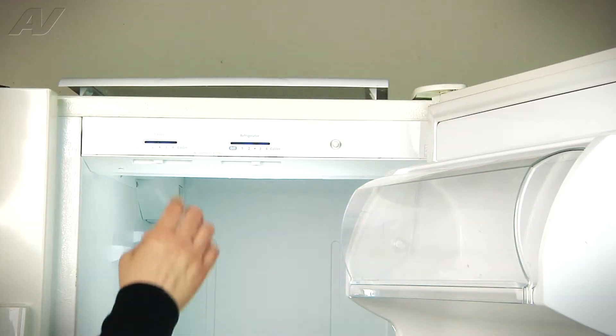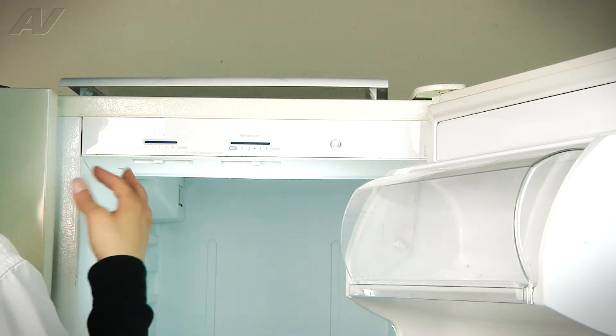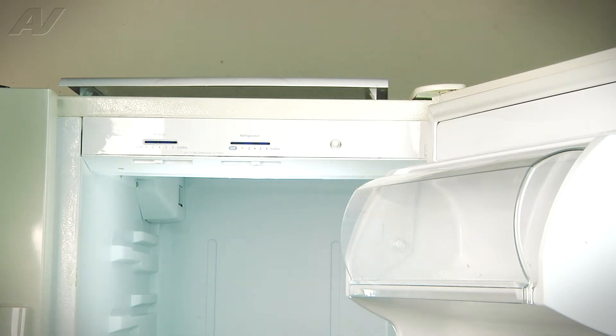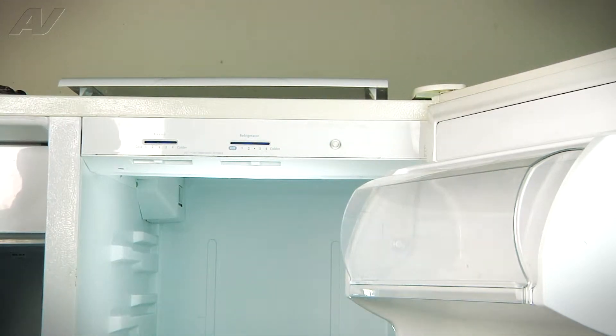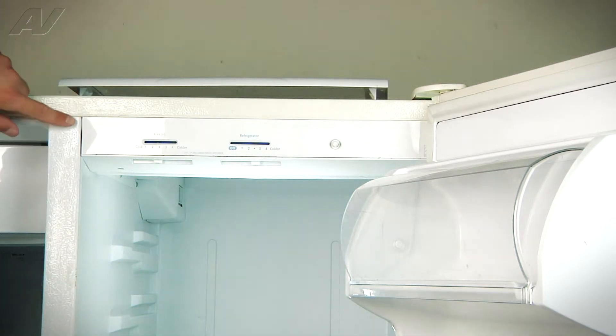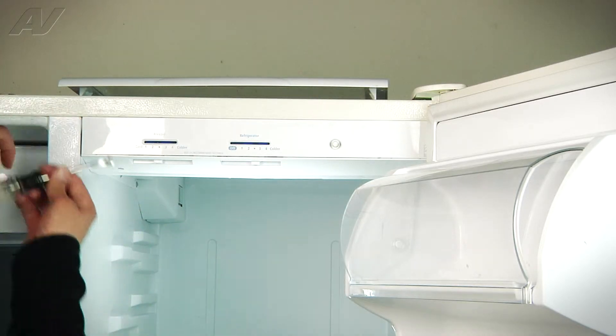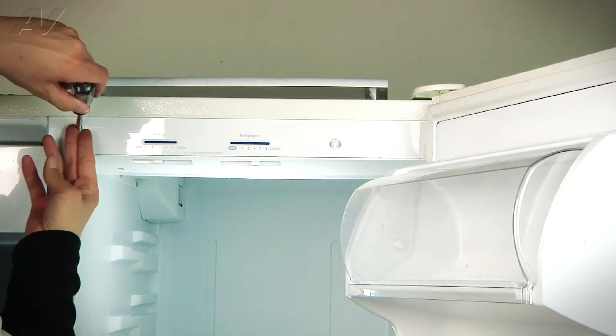What we're going to do first is remove the fascia off of this control housing. It isn't necessarily the easiest part to remove. It may seem and feel like you're going to break it as you're doing so, and you very well could, so just keep that in mind. What we're going to do is open the freezer door. I'm going to use my tack puller and what some people will do — and what is not necessarily a bad idea — is to put a little bit of tape right here so you're not putting metal on the actual unit. I'm just going to go ahead and put my tack puller in here.